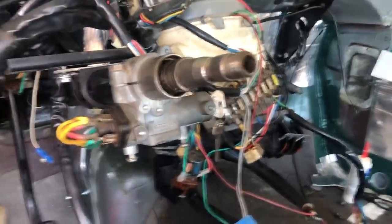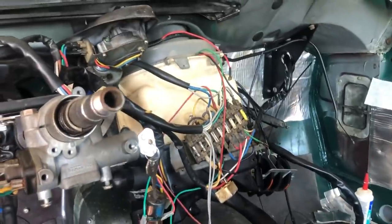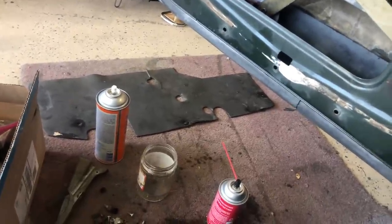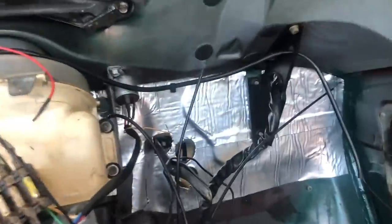Time for an update. I'm back here working on the inside. I've started connecting things — the heater box is in place, and I've reached the wiring at the firewall. I actually had to do the blanket and then took it off, because the glue I put on the backside didn't hold. That blanket is heavy — it's dense material, and while it's fine on the floor, when it comes to these vertical surfaces, it's no wonder both cars had the blanket falling. So I like the sound deadening that I got and I've applied it all around these places. Some of these cuts aren't very pretty, but they're there — this is all behind the dashboard stuff, so it doesn't bother that much.